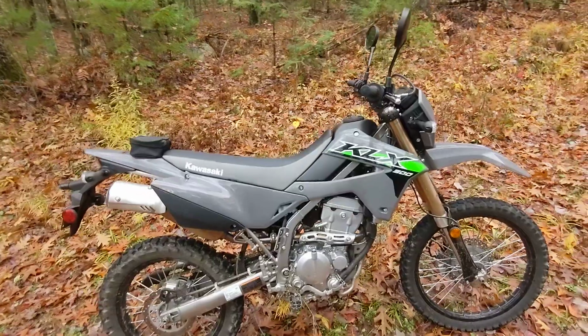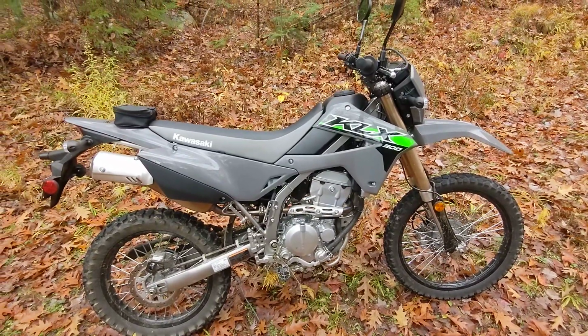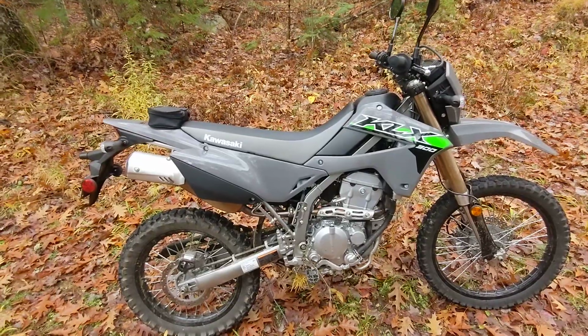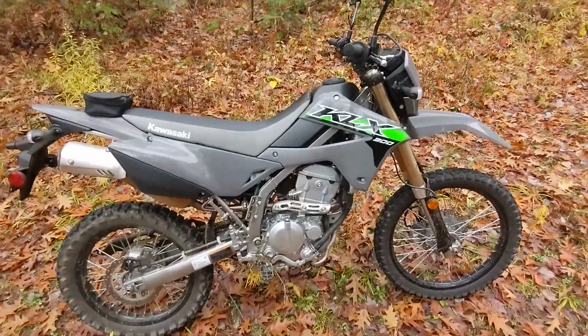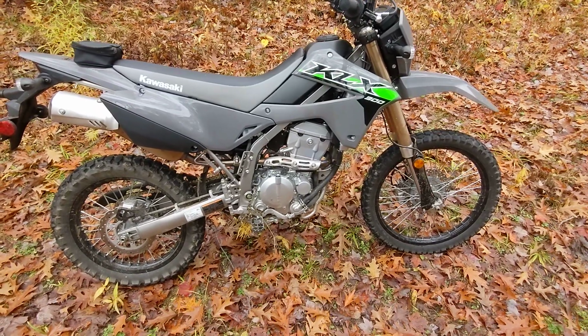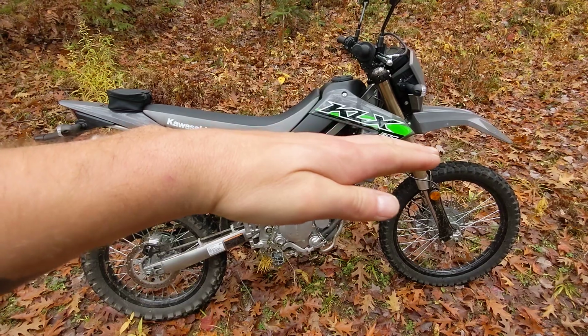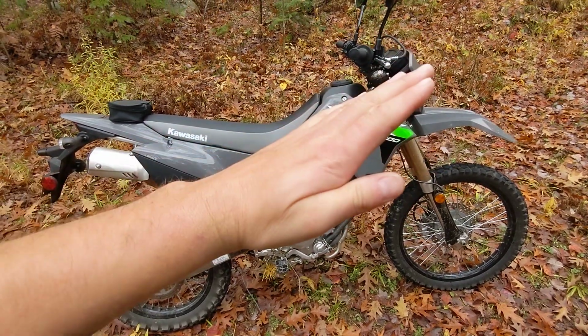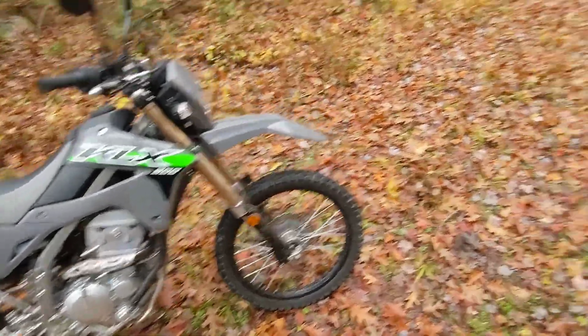Well, let's talk about sag. You don't know that. You don't have your bike set up properly. You don't have the right rear spring in it. So if you don't know what sag is, it's the weight distribution front to back. You're too heavy for that rear spring, so now you're going womp. You don't have any weight in your front tire. Of course, it's going to push, slide, skate.